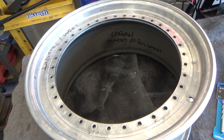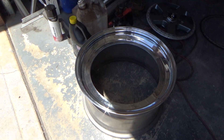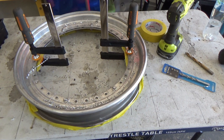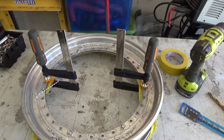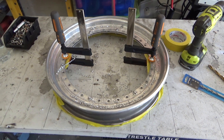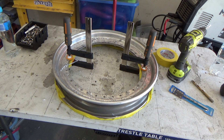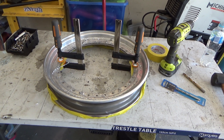Two barrels, two lips done. One lip here still to be done and working on one lip right now. Pretty simple - clamp one of the old lips onto the opposite side. A couple of bolts just as extra positioners. Then just going around drilling 7.5mm holes. Actually didn't take too bad - still on the first drill bit and I'm onto the fifth piece, so overall not bad.